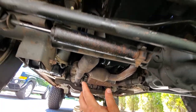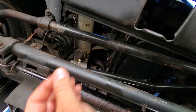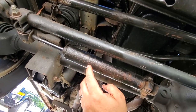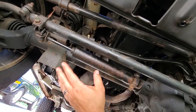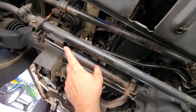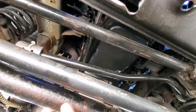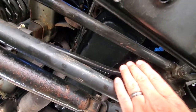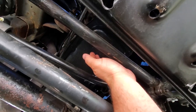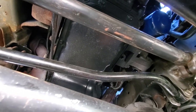While that's still trickling, I'm going to look around and see if I can find any evidence of other oil leaks. I can see some oil up here and some oil down here — definitely some on the steering stabilizer. I'm going to change this. I wanted to do this very last because I wanted to make sure I cured death wobble before I did this. We all know this is not a cure for death wobble — it's just a band-aid, so I'll put this on when everything else is done. A little evidence of drips up here. So I'm thinking maybe I have a slight oil pan leak. I think I'll just go around the pan and check all the bolts after I put on the oil filter.